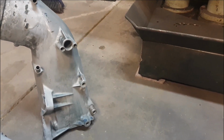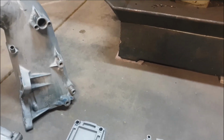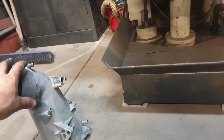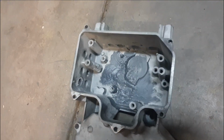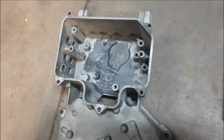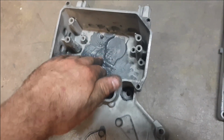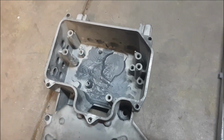We drilled them out and re-tapped them, so the temperature sender is going to be bolted with two bolts this time around. When I bought it, there was one snapped off and I just never went ahead and tried getting that bolt out, and the same with this one here. The electrical box, we took care of this hole here and this hole here, so we've tapped them out, we've got screws, run them all in, made sure it's all fantastic. As you can see, I've put a bit of JB Weld on the inside of this as well, just smeared it in for a bit of extra backup.